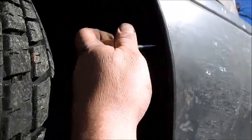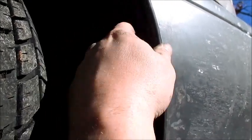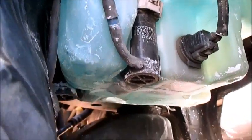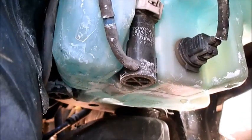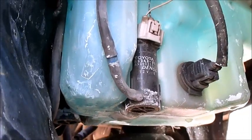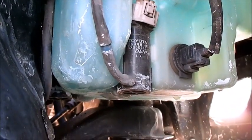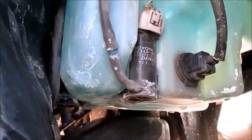This is just a Phillips head screw — this could also be a Phillips head screw. Why don't I just do it right now? Just undo this one. You can almost get a hairdryer in right now with just that one. There's your two pumps — those were in fact frozen. Just that one fastener will probably get you enough room to get a hairdryer in there, get some warmth, or maybe a heat lamp. But always be tending that heat source so nothing bad happens.